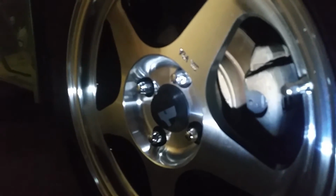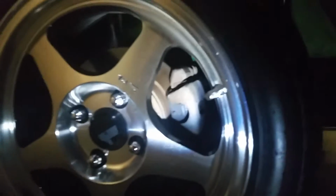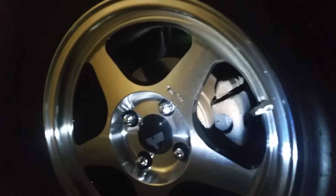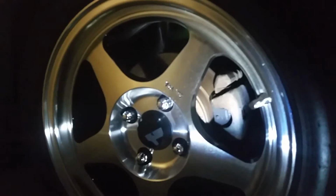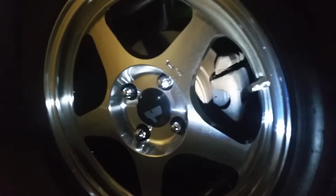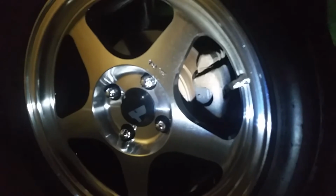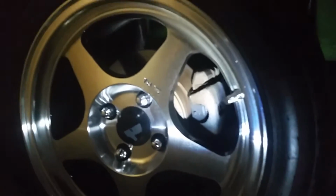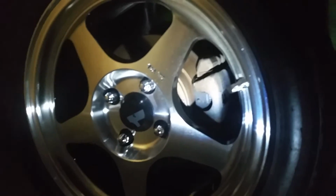And again, pretty hard to see, but I pulled the rear brakes off the Honda as well. So machined the stub axle to fit inside the moke trailing arm, and put the whole Honda rear disc brake assembly onto this moke. So we've got Honda bearings, the whole lot. Well, we had to maintain the swivel arm out of the old disc brake setup at the front, so we've still got 50-year-old technology bearings on the front. We've got a modern 1994 rear setup 100%, and really good.